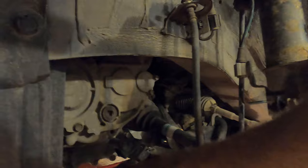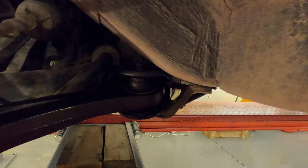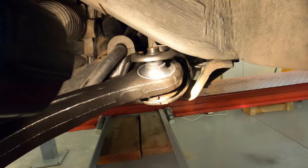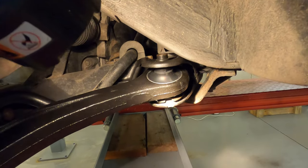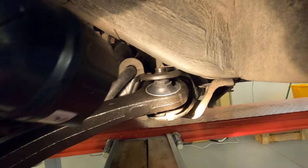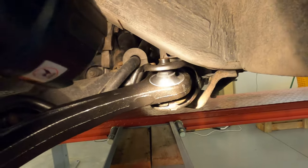We'll pop the castle nut on top to hold it for a minute while we get our front 22 millimeter bolt in — we'll have to wiggle this around to fit it in. Then the back 19 millimeter bolt goes in from the bottom. I'm having trouble getting the back bolt in because the truck is jacked up and the spindle is just hanging, so the bolt won't line up. I think I'm going to get this ball joint hooked up first.